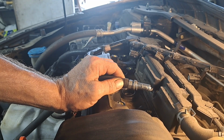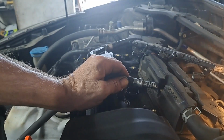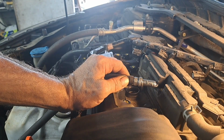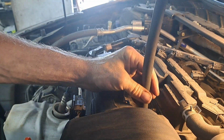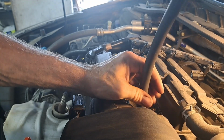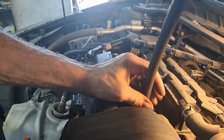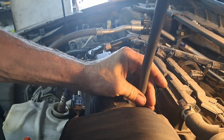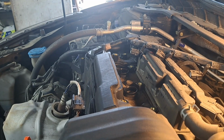I'm only saying that because I've seen it done. I've got into cars and took them apart, and I was like, oh wow, they use anti-seize because they're like, well, keep the boot from being seized. So basically, we don't do that. You use a high voltage base silicone grease that doesn't harden up. It just stays solvent. Anyway, so we'll turn this in until it tightens down, and then we're good. We'll move on and do the other 3 holes like that.